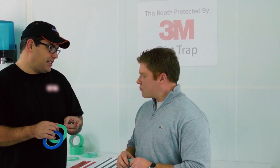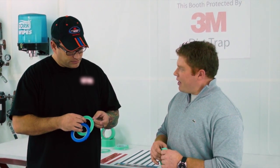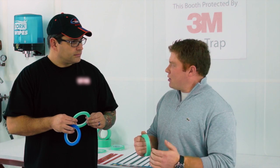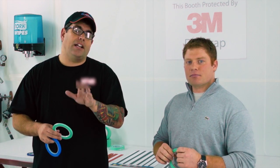When it comes down to things in a shop, it comes down to time and money — so how is this going to save a guy time and money? This is going to be a lot faster and create a much better paint line. You don't have to do multiple layers of taping if you're doing a critical edge or taping on a blackout area. It's just one strip of this with the paper and you're done — you don't have to set up your fine line and then back-tape over it, so it's a lot quicker. You're using a lot less tape, so it's going to cost less money as well. And I'm not going to pull up stuff I don't want to pull up — that's one of the most important things. We're going to spray some paint, put it down, and show you firsthand why this is going to save you time and money.